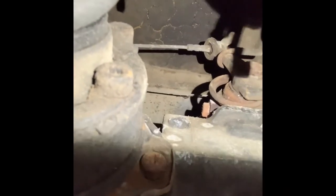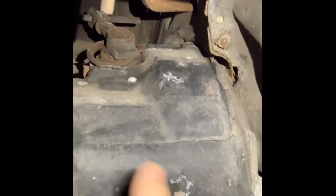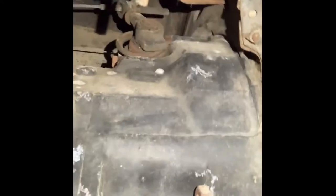From the looks of this one, it looks like it's been twisted all the way, so when this one starts to grind, that's probably going to be it — there won't be any more space. But if you look on yours and notice that your screw is maybe in the middle area, that means you have more meat. You can screw this part down more, and that'll give you a little more pull on this arm, a little more meat on the clutch.